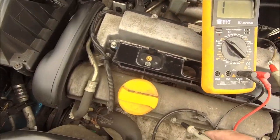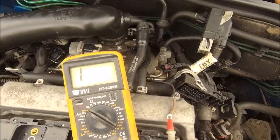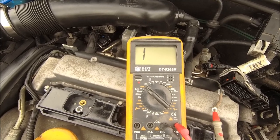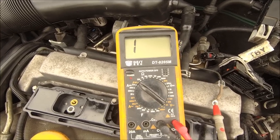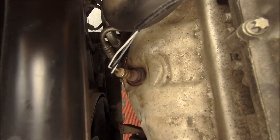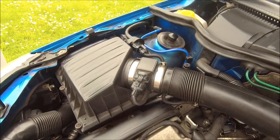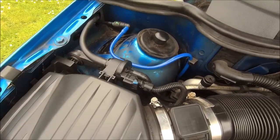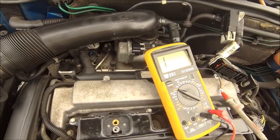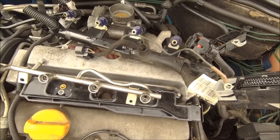That connection is on the engine itself - nothing wrong with that lead. I did wonder whether it was power to the ECU causing the problem. I've had so many thoughts. I've tested the fuel pressure - it's not that. I've had the O2 sensor out - it's not that. I've tested the throttle body to the best of my abilities - it ain't that. The MAF is working okay. A big problem can be the valves - that's working absolutely fine. I really don't know, this is becoming the biggest mystery I've ever had.